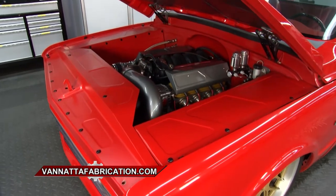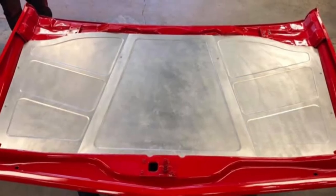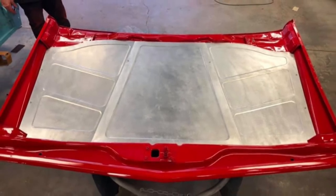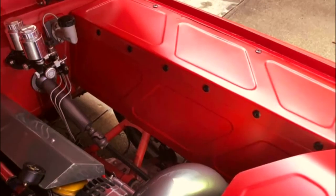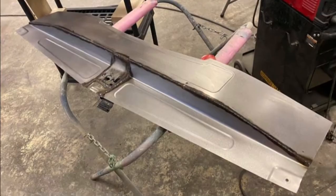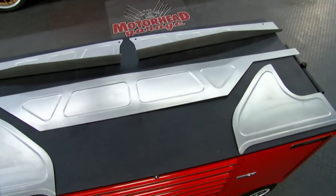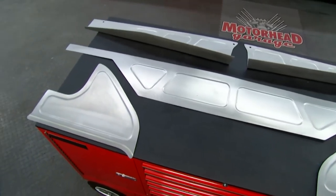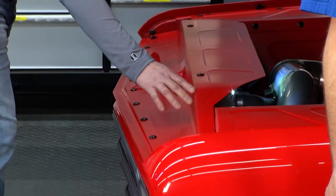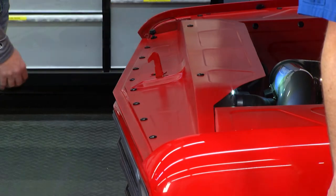Not just for looks on the outside, but we popped the hood and it's a great-looking truck underneath. These are our under hood panels — typically aluminum just to keep the weight off the hood, so you don't have all that weight on the gas struts. These are our inner fenders, two-piece. This is our core support filler panels and our radiator cover. I've welded it all together and welded it to the hood latch. These just drop in place. Once you bolt it all together, do a little bit of fitment, and you can start tacking this together, then just take it off to finish it out.